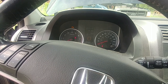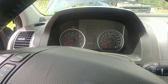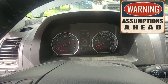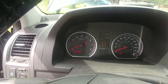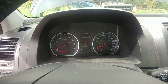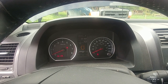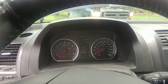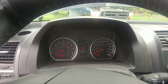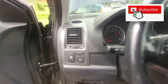That's something. It seems like the starter might be having an issue, or an electrical short that drained the battery — that's my assumption. The engine light disappeared, all good there. It's a single click, so we need to verify if we're getting power down to the starter control wire terminal and go from there. But the battery definitely needs to be charged.